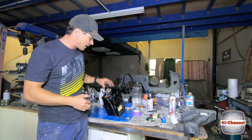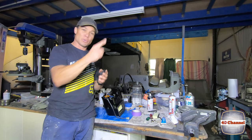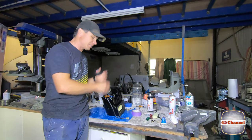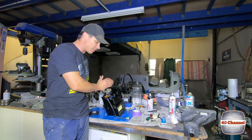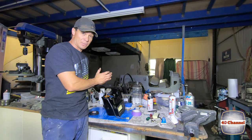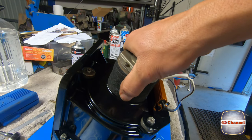I've really finished this off to give it that original look. I pulled all this tape off — I actually removed the top, checked the brushes, checked the comm, checked the motor. I pulled it apart and the springs flew out, the brushes came out — it was a real pain, had to find them all and put it all back together. I thought I'd refilm it to show you guys but I just didn't want to go through that pain again. So if you do go to pull this off for any reason, just be very aware — when you pull it off, pull it off very slowly. The springs behind the brushes will want to fly out and go missing. Maybe pull it apart and try to cup it in your hands to catch those springs, because it'll be a real bugger if you lose them. But to finish this look off, we're going to use our cloth tape to give it that more original look. We might even paint the top here and give it a silver paint at the top.